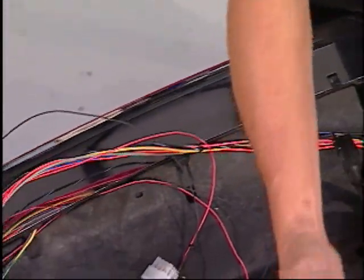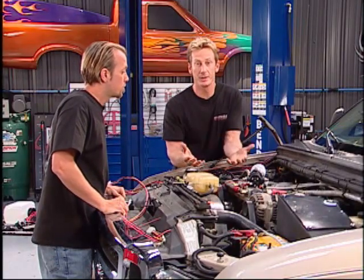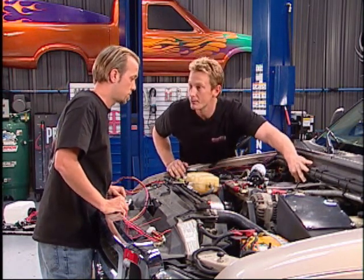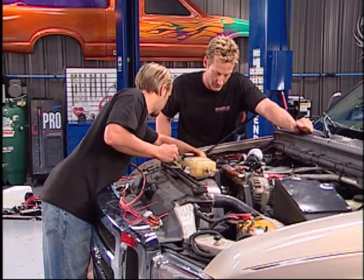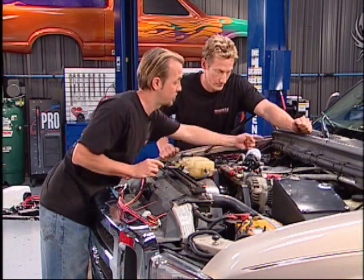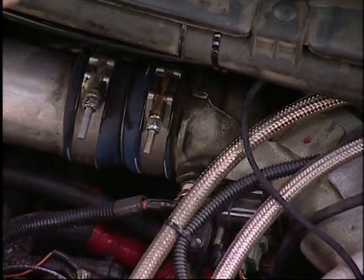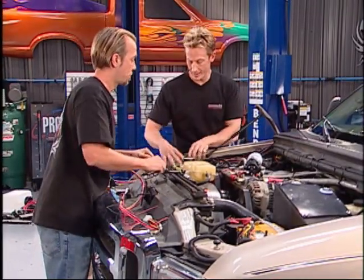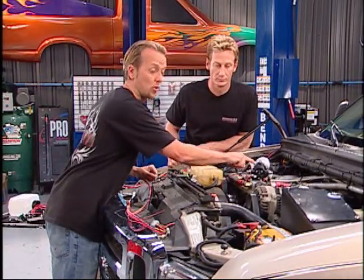Now what we need to do is figure out where everything's going to go. Before we get too far into this wiring, we need to figure out where all the hard parts are going to go, and first of all, where the cold shot's going to go. If you look through the instructions, as you should, you'll find out that you really need to put this post-intercooler. So I'm thinking right here would be about right — this would go right into the intake. Sometimes people will mount those in different places, and every now and then we've heard stories about them going really low. Keep in mind, you're spraying that water in and it's got to travel all the way up this tube and around — that water doesn't want to go uphill. You want the path of least resistance — stick it right in there so it's spraying right down there and you're getting the full optimum performance. So let's go ahead and get some of these hard parts mounted up, then we'll know how long to make these leads.